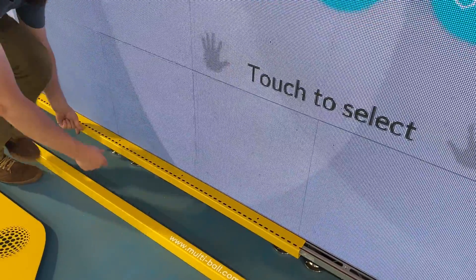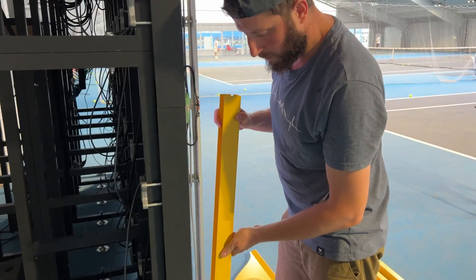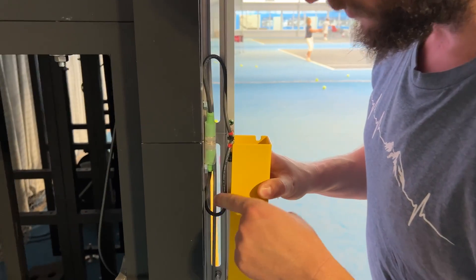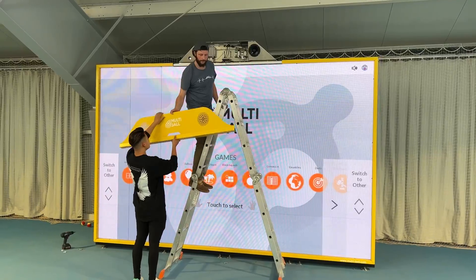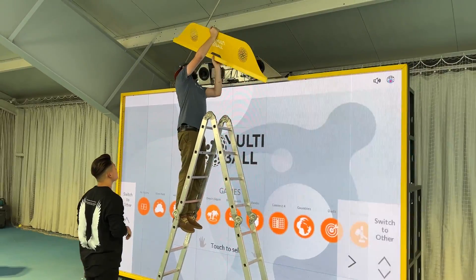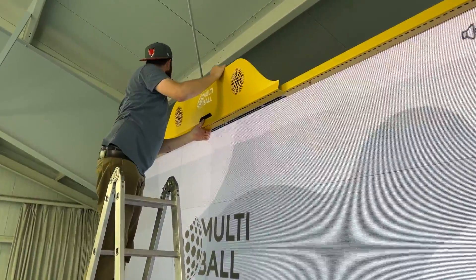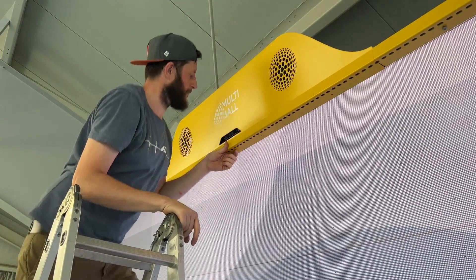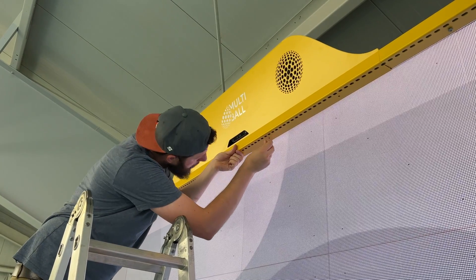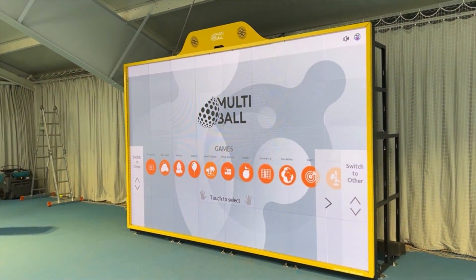Be careful — the sensors fit perfectly, and then you put the little screws into these perfectly aligned holes. When you attach the side covers, make sure you're not squeezing the cables, so just put it in tightly — if they are like this, nothing can be hurt. The very last step is to attach the console cover. That's always best done with two people — it's not that heavy, you just hang it in to the top and slide it down. There are two little knobs on the top to attach it nicely. Then you push it back and attach the screws. And that is how you install a multiball LED from top to bottom.